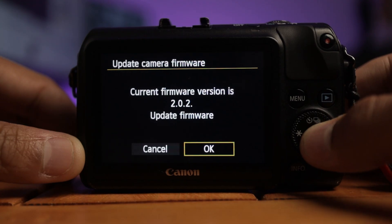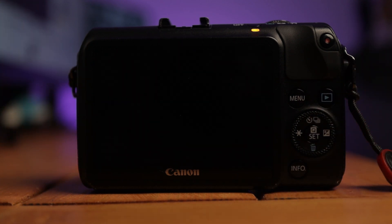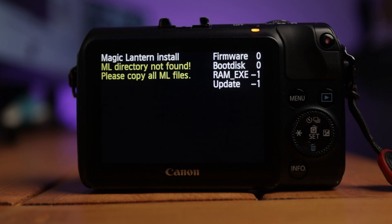I just got done shooting all the b-roll for this video but I had a tough time actually getting Magic Lantern installed on my camera — not because it's difficult, but because of the newest update to the Mac operating system. If you have a Mac and you're running the newest OS, Big Sur, it by default formats SD cards in a different way. When formatting SD cards there are a couple different formats, and there's one called exFAT which allows SD cards to be read by both Macs and PCs. But the build of Magic Lantern that most people use — the one from Zeke — needs MS-DOS FAT formatting to work. I'm going to show you quickly how to check and fix that.